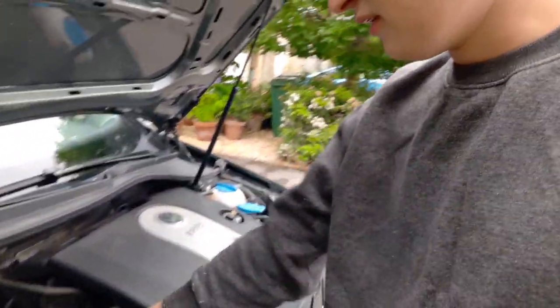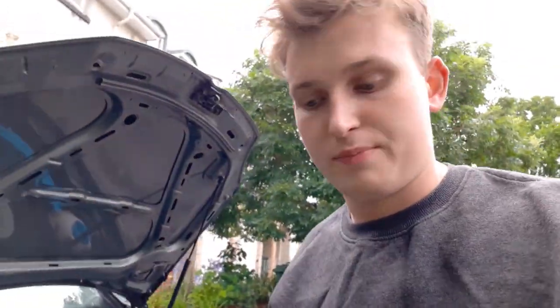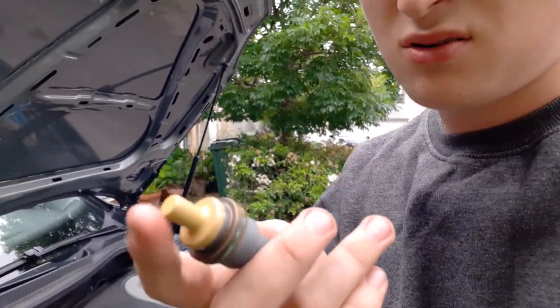What I'm going to do is reconnect the loom, leave it for about a minute, reconnect the battery, start her up again and see if the fans persist. The hard reset did not work at all. On the new temp sensor which I purchased — we realized that was not the issue — so we swapped it with the temp sensor from the other location, which leaves the original sensor in my hand here. It's yellow, and I'm not sure if that means anything.